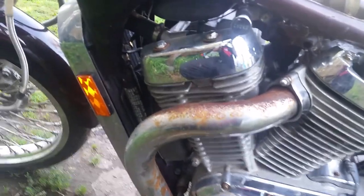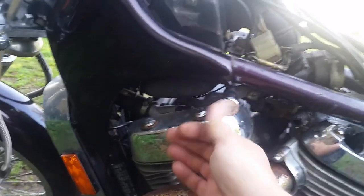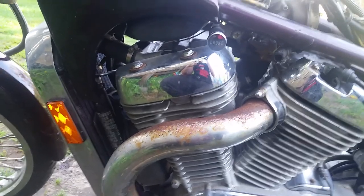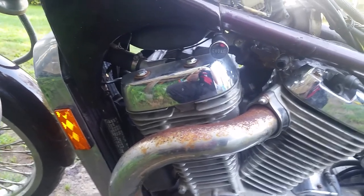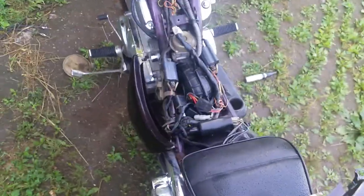There's no detent on the choke — it just wants to go back in like a pinball machine. The bike does not idle at all. You basically have to hold the clutch in to turn it over. It's a hydraulic clutch and I got that to work. I put new brake pads in it, and now I've got to mess around with the carbs. There are two carburetors on this — you have to remove the fuel tank to get to one.